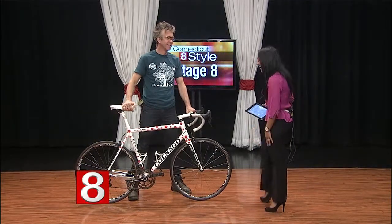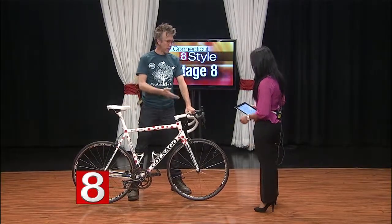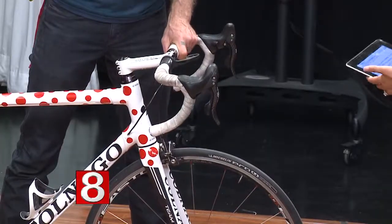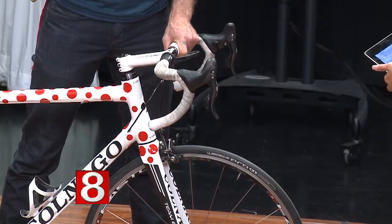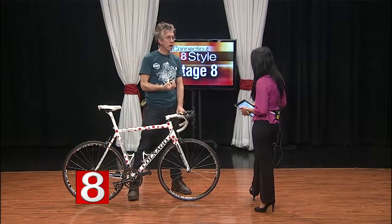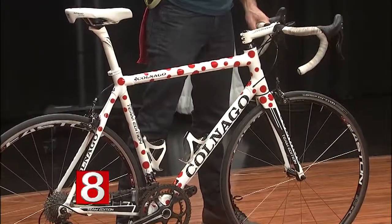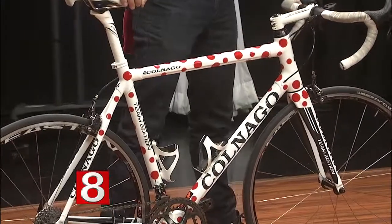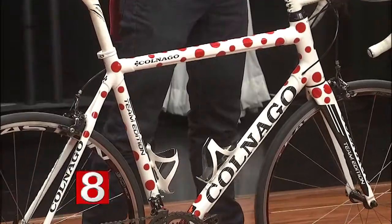It's common sense. And what could happen to the bike over the winter? A lot of things can happen to the bicycle over the winter. You heard me mention wet rot and dry rot. Dry rot is when inner tubes rot. If your bicycle is in a dry environment, the latex slowly seeps out and they become very brittle. Or it can wet rot if it's sitting somewhere like a wet basement, and that's just as bad. The composition of the tire is not as strong, and you can risk having a blowout.